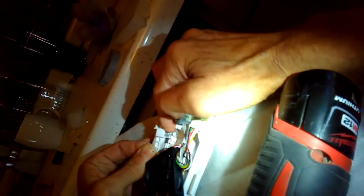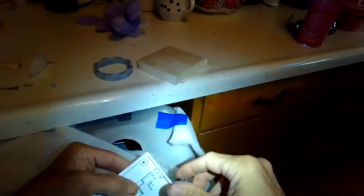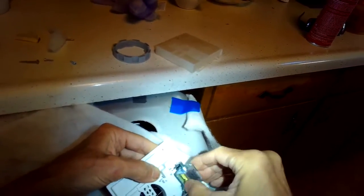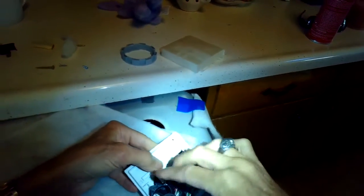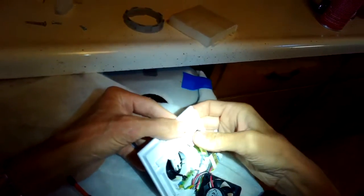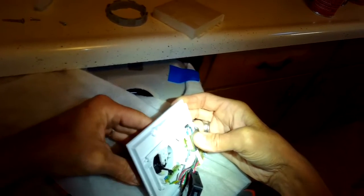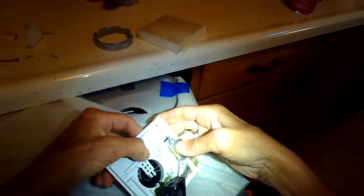So I'm putting the spring back in after I stretched it. And that's one thing that may do the trick, that may help this situation. Also, just cleaning that black round piece and the black rubber gasket around it can help. Sometimes you get some soap scum and gunk up in there that's blocking it from closing. So if you look at the black plastic piece, you'll see there's a protrusion that goes up into that tiny circuit board, and it blocks the light.